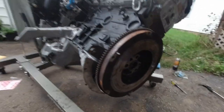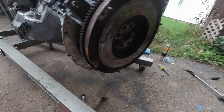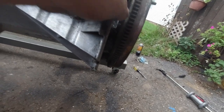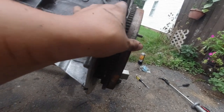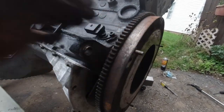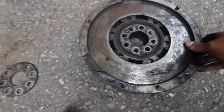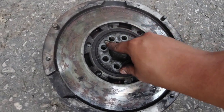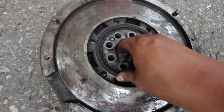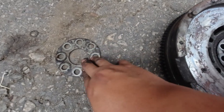We're going to be using the single mass flywheel just because it's lighter and it's going to be better for faster revs. The only issue with the flywheel from the M30 is that it's going to be hitting the oil pan. Most people machine this piece down a few millimeters. What you can also do is take the spacer out of the dual mass flywheel from the M52 and put it behind — it'll space it out just enough. It almost looks like the E31, but the E31 goes in the front instead of the back.